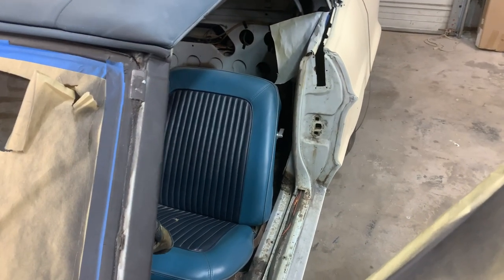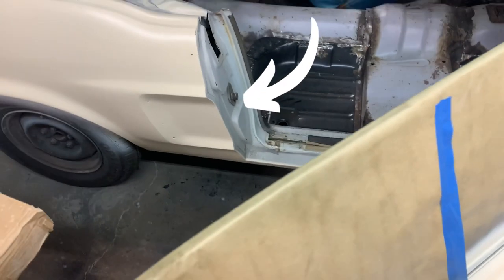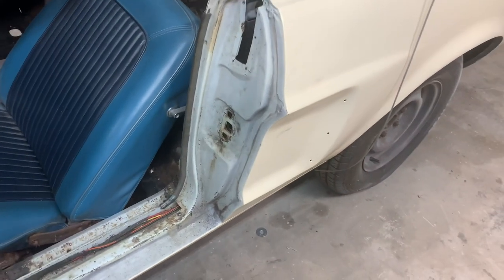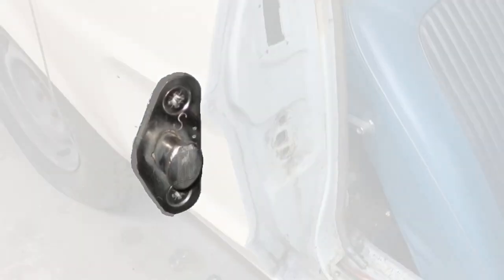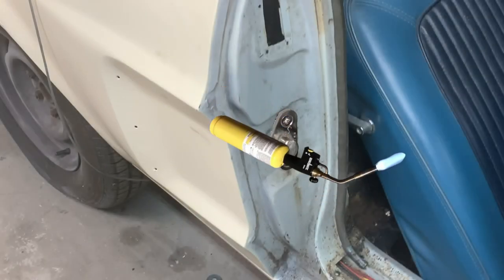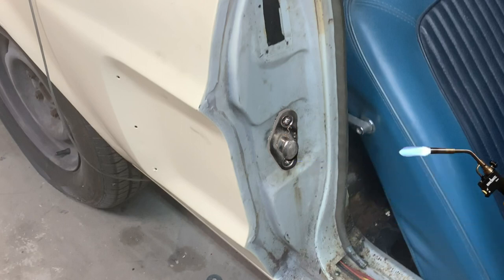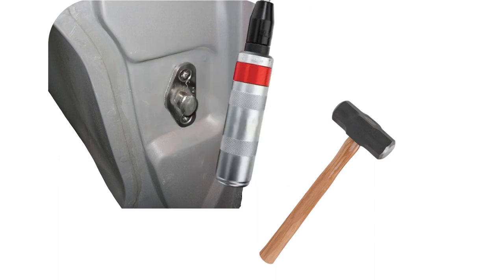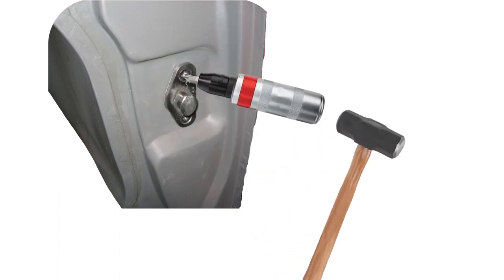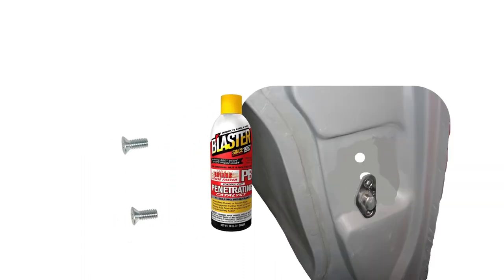To start, it's best to adjust the doors with the striker plate removed. The striker plate is inside the door cavity on your classic Mustang, commonly known as the B pillar. To remove the striker plate, you will likely be best to heat up the screws, as over the decades they have likely seized up. Heat it up with something like a simple butane torch. Then find a driver impact screwdriver set and use a little persuasion to get those screws loose. Add some penetrating oil in there too.